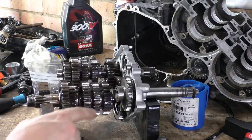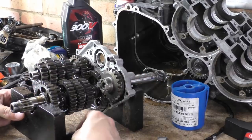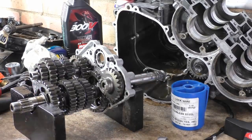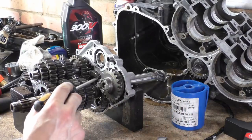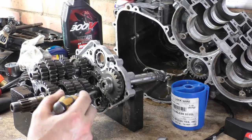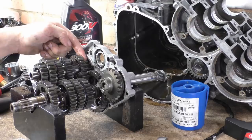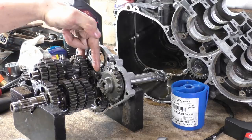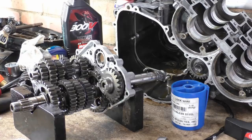So it's actually a mechanical device. Now, the weirdest thing is the way they've done it here. It is input shaft into first gear, but it's the movable gear, so this is the freewheel spinning gear, and then straight onto the shaft, the fixed gear. So basically this is gear one, but it's not using this shaft, hence why you can basically start this thing in neutral.